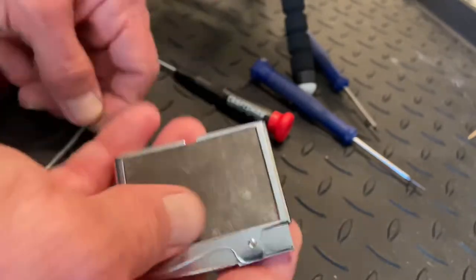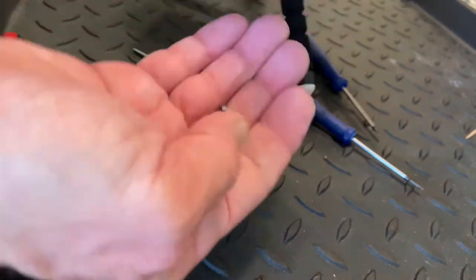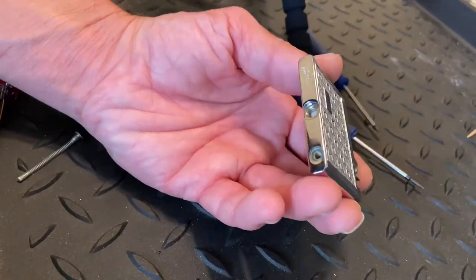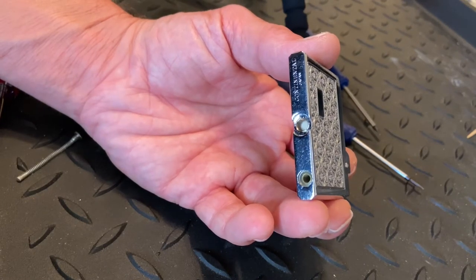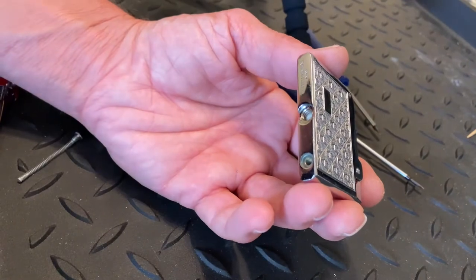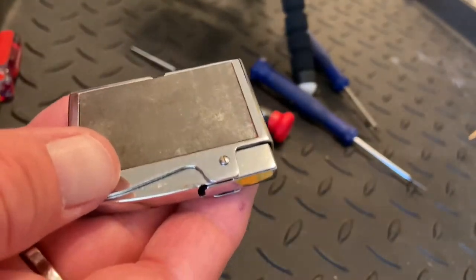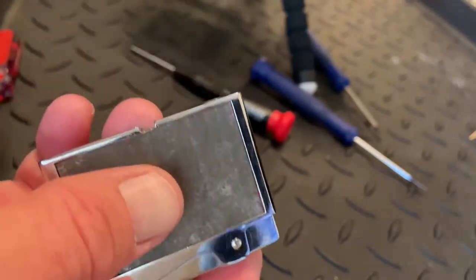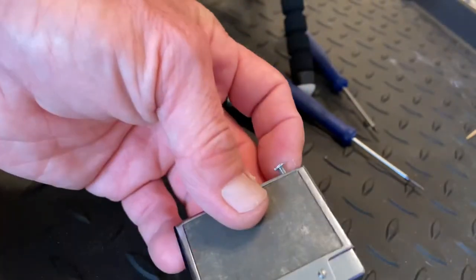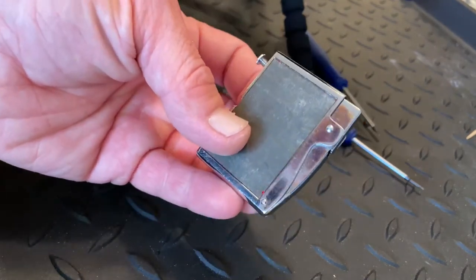But on a lighter you just purchased on eBay, a lot of other eBay sellers may not be quite so honest. You may purchase a lighter that says it's in good working condition, and when you get it home and try to put a flint in, you realize the old flint has degraded and is obstructing the tube.